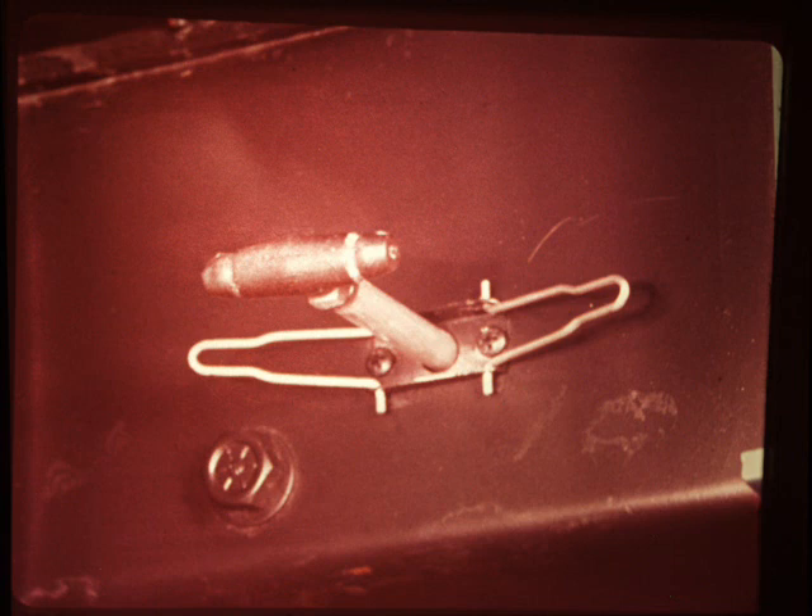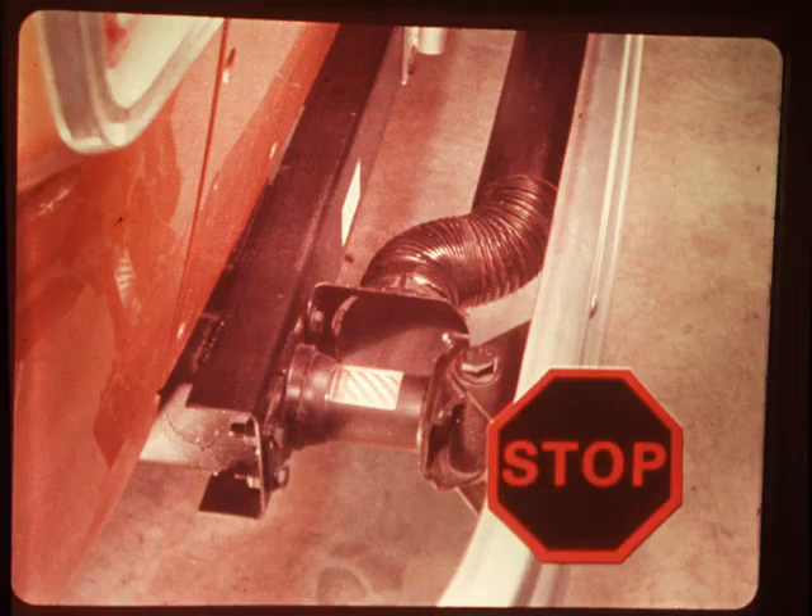To actually drain the holding tank, release the two snap retainers at the control valve and pull the handle straight out — the valve will open and the tank will empty. Procedures for draining the holding tank will vary slightly on vehicles built for sale in the state of California. To thoroughly rinse out the tank, close the control valve and add several gallons of water to the tank through the toilet, then pull the handle to rinse the tank. Before you disconnect the hoses, be sure that the control valve handle is pushed in as far as it will go and that the snap retainers are relatched. Then reposition the extension hose and dump hose, and don't forget to replace the dust cap.